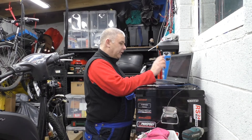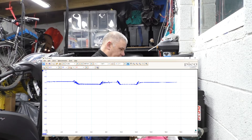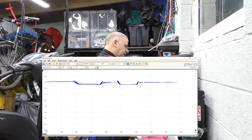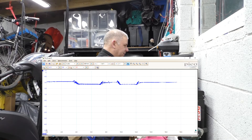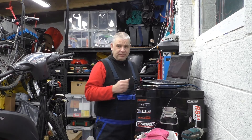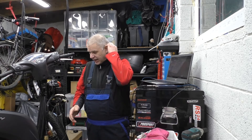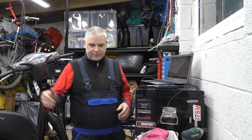You can see on the oscilloscope screen - voltage on the Y axis, time along the bottom. This is not a nice easy clean signal. It's not a steady 0.35-0.45V at closed throttle and it doesn't go up to 4.5-5V at wide open throttle. It's stuck at 3V, dips a little, goes up a little. The interesting thing is the voltage actually drops when you open the throttle - and it should go up. That throttle position sensor is pretty dead.